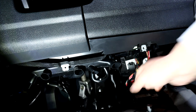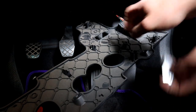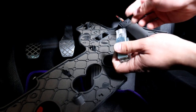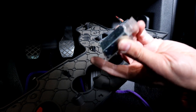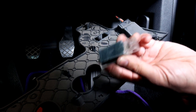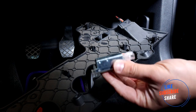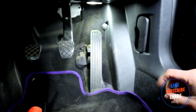On the left side there's a little plastic tab — squeeze it in and the bulb comes out. Push the plastic bit in from the left side and out it goes, nice and easy. So you don't have to struggle with the screwdriver. Get the cover off, get the old one out, put the new one in, slide it back in, connect it, check it's working, and job done. Sometimes when you replace a lot of bulbs at once the electrical system can get confused, so you might need to disconnect the battery for five minutes or cycle the ignition, and it will fix the issue. Don't start worrying if it's not working straight away.